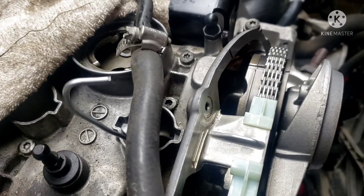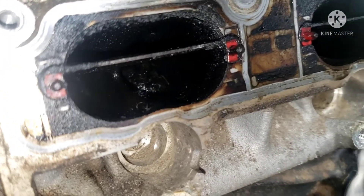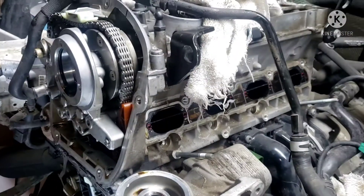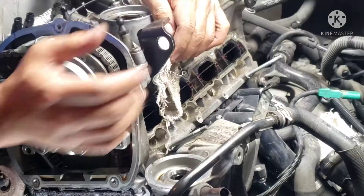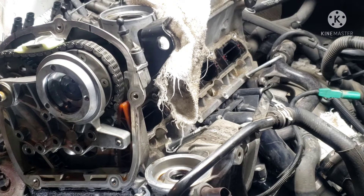So this is on TDC. I've got the piston way up to the top, which means all the valves on number one should be closed - there's the valve right there, so that means it's closed. What I'm going to do is blow through the spark plug hole and then watch for this cloth to move around. I can feel it with my hand - there's airflow in there, so the intake is for sure a bent valve. That's one quick way to diagnose if you're out in the field somewhere.